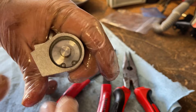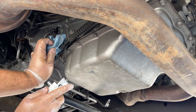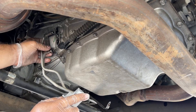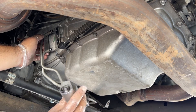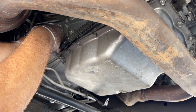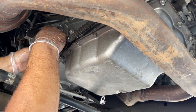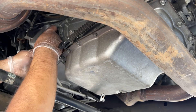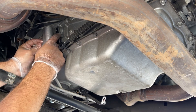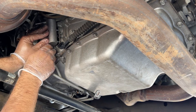Quick inspection — everything's installed properly, so it's ready to be reinstalled on the truck. Double check again to make sure both of these O-rings are where they should be. You will run into problems if you install that incorrectly. Stick that back on, and make sure these are bottomed out as much as possible. If you have any leaks, that should be the first place you check — right along where these two lines bolt in. Doing this finger tight, then take the entire assembly and throw it back up and in.